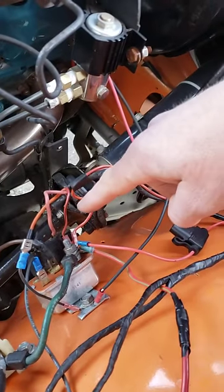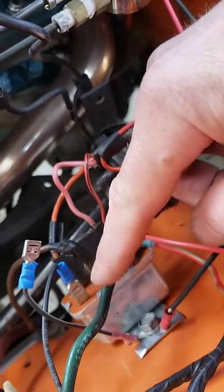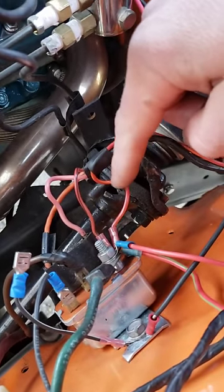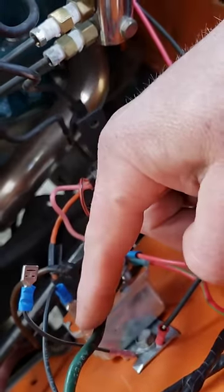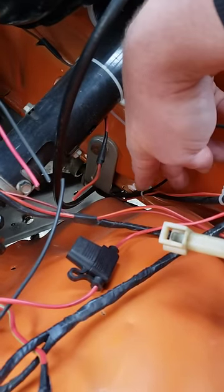The problem is right there. The other wire I mentioned not being fuse protected - there's a heavy fusible link here, but that's not going to protect this smaller wire. This smaller wire would burn up first before that one anyway. That wire goes down underneath.